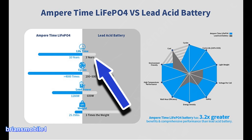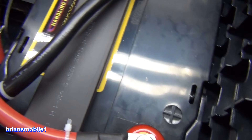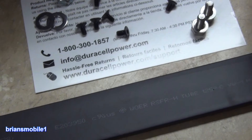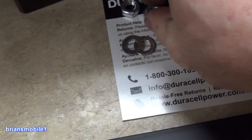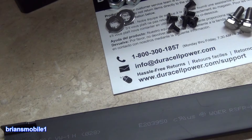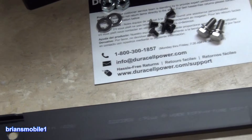In reality, this thing's only made to last three years, not ten. So a lot of the weight is just the battery — the case itself isn't that heavy duty. In order to get the battery out, you need a 3mm Allen wrench to pull out six screws, then a 14mm and a 10mm for your terminals, and you're in.